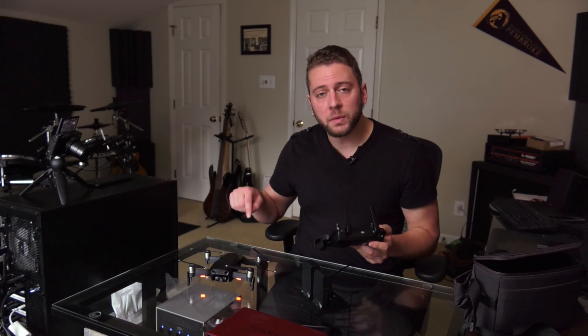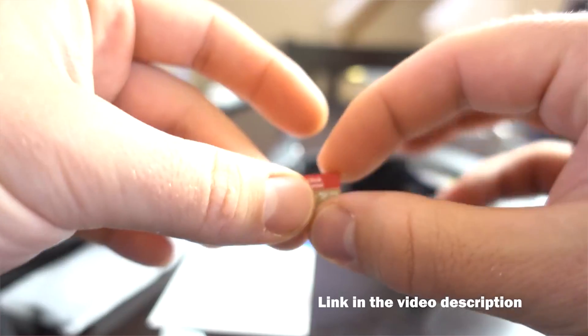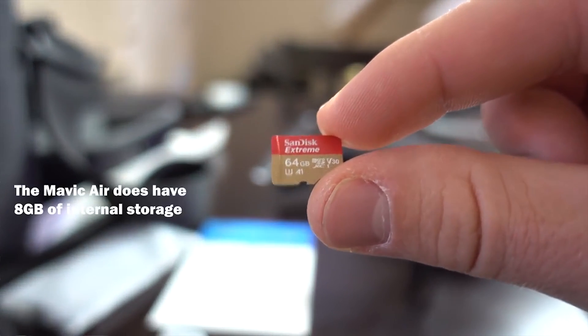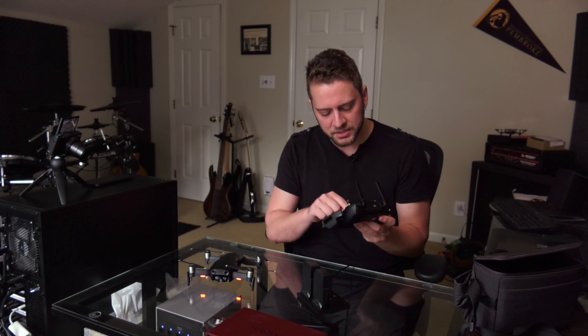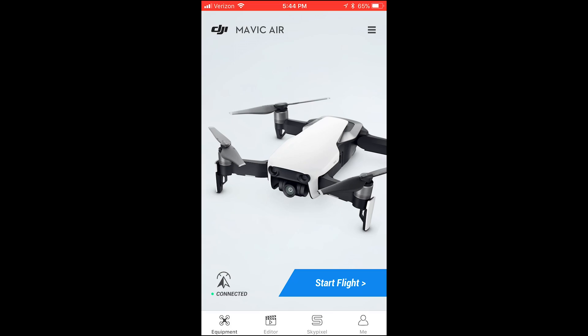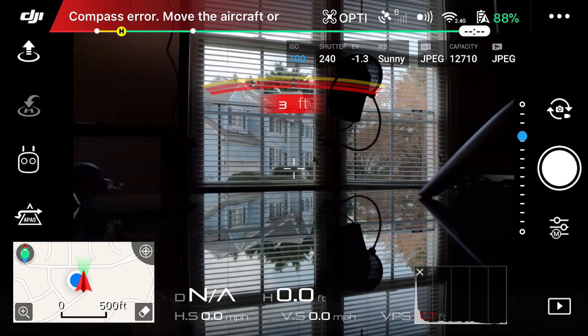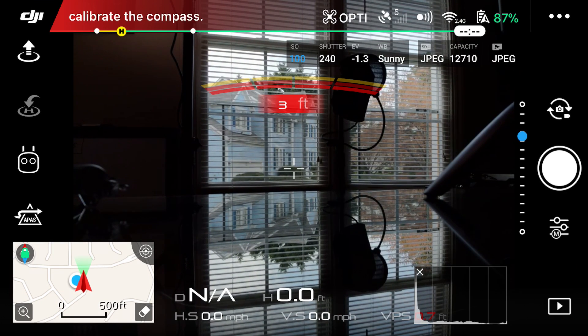It's also at this point that you want to make sure your microSD card is installed in the back of the drone. If it didn't come with one, you'll need to get one if you want to record footage — however, there is 8GB of internal storage inside this drone. Now, let's go through a few more options in the app before we get out to the field. We're going to hit Start Flight at the bottom. On the top left, it's saying Compass Error — move the aircraft or calibrate the compass. I am on a desk that has metal in it, so this is not going to have good compass calibration. We're not going to do it here.